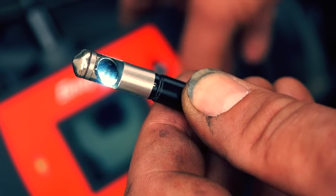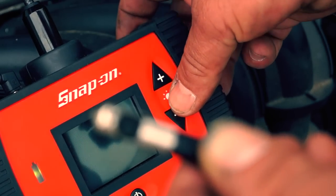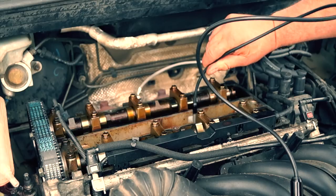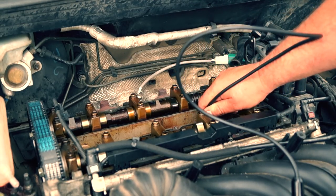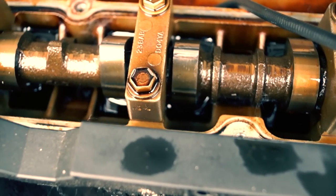You can either turn the lamp off, turn it bright, turn it dim, or turn it right off. The biggest downside to this is the probe - you need an aperture big enough to be able to push it into, so with some diesel engines you can't look in there. To check this I need the valves completely shut and the cam in the correct position. You can see where the heel is, and going into the bore I'm taking a good look.